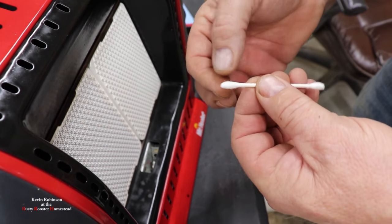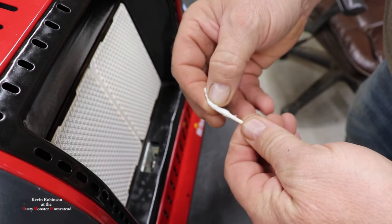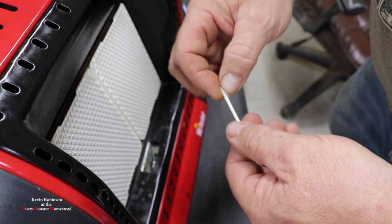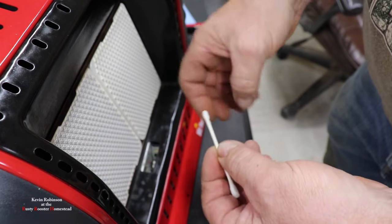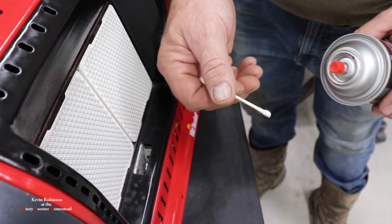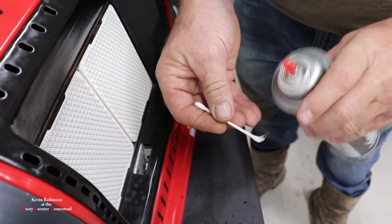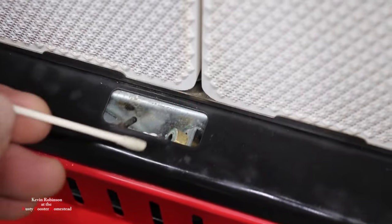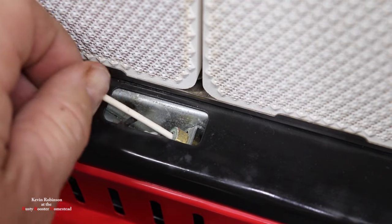What we're going to do is take a Q-tip and pinch a little bit of it off, because we don't want all of the cotton — just a little bit. We're going to take some off and then spin it to make a tiny Q-tip. We want it spun on there pretty good. We don't want a giant one because it's not going to fit in the hole. Once we have our Q-tip real small, I'm going to take some brake cleaner and spray a little bit on that tip. Then we're going to take it and stick it right down in here to clean out any dust.